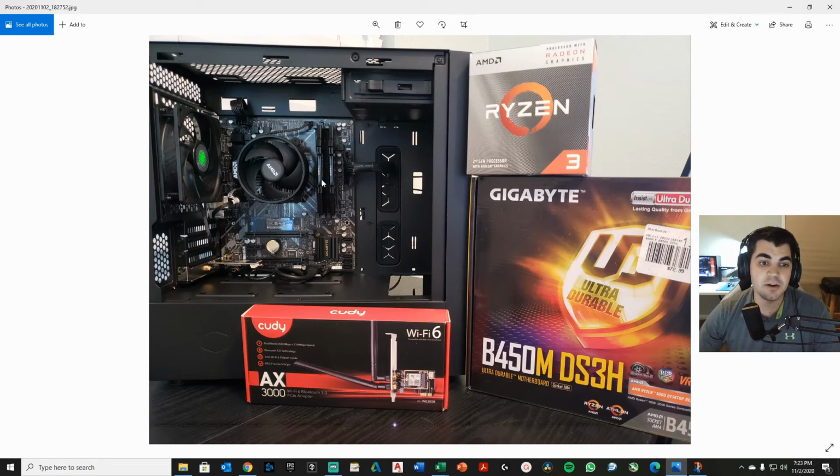And then it's just a matter of putting the motherboard in the case and plugging everything in. You have your 24-pin connector and your 8-pin connector plugged in, and then your front panel headers, you've got to plug those in. So USB connector here, your audio usually goes over here, and your front panel power button with the LED and the reset switch goes here. And that's it. The hard part sometimes is actually making sure that you run all the drivers that you need for Windows.